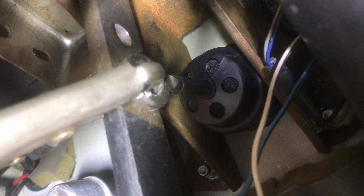I bring it down there, my pedal's perfect. I have not a problem. I got a nice hard pedal. All the what seems like a bad booster, bad master problems go away. So I must be in the upper position. I must be just enough at an angle that I'm bleeding off air or vacuum internally or something, because it's not like an external thing.